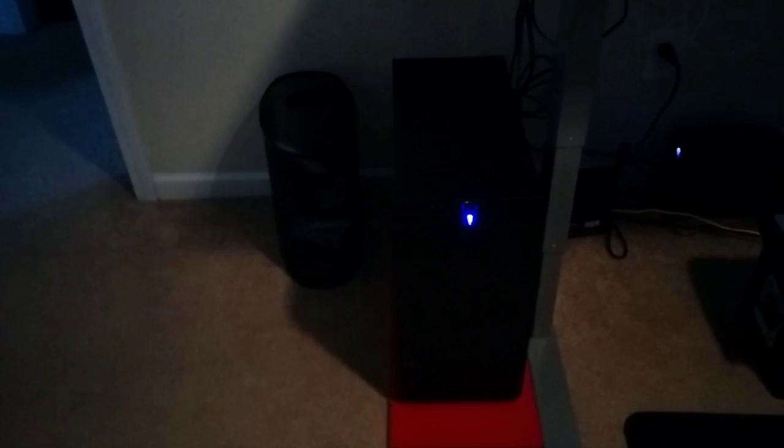But the big change in the digitalia world is down here. I blogged about this so I won't go into too much detail, but I decided I just wasn't a laptop guy for my main rig. I'd been running a Lenovo laptop as my main rig for the last few years, and it just never left my house — there's no reason to have it as a laptop. So I built this in the last couple weeks: it's a Skylake i3 with 16 gigs of RAM and a 500 gigabyte SSD, and it screams. I also went with a 500 watt fanless power supply because I wanted to be as quiet as possible — I hate machine noise in my office. I was able to get one on eBay for like $60, which is incredible for a fanless power supply, brand new in a box.